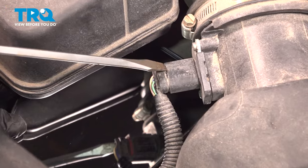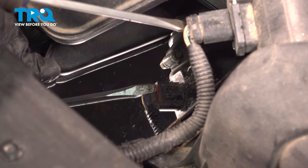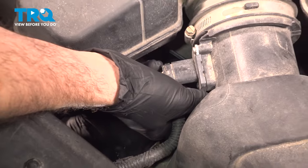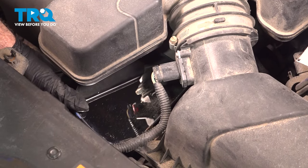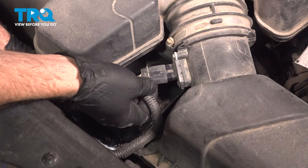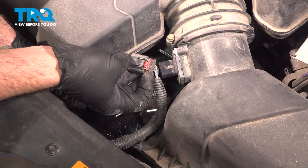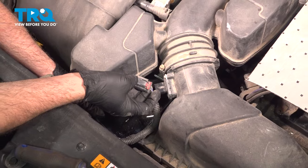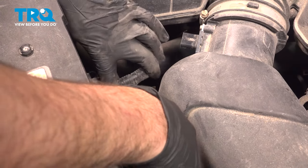We want to remove this connector here. Now we're using a mirror right here to look on the bottom side of our sensor, and there's a red lock tab there. We need to go ahead and pull that out, and when we do that we're going to compress the little tab behind it. Now that we have that red lock pulled out, I'm going to reach up, press the little tab and slide this off. When we reinstall this we're simply going to push this red lock tab back in to secure it in place. We have our wire harness right here — we're going to use our trim tool to pop that button up and out.